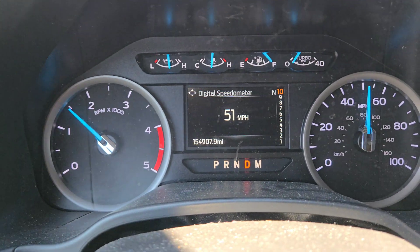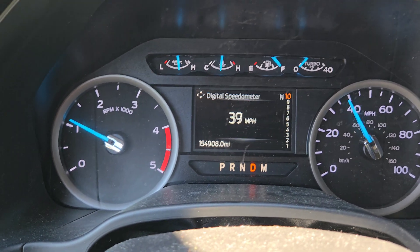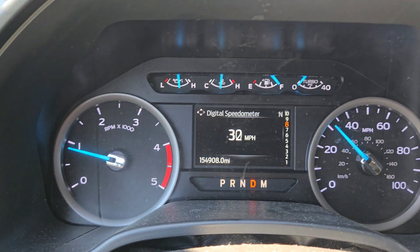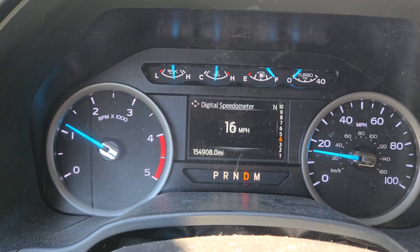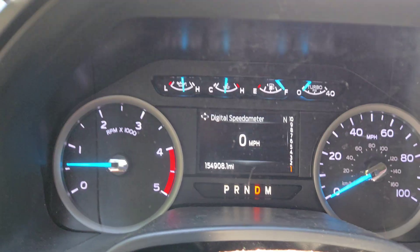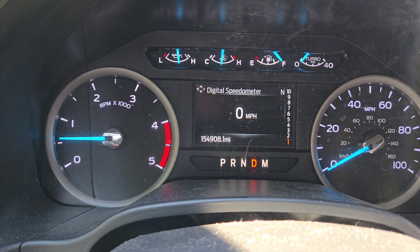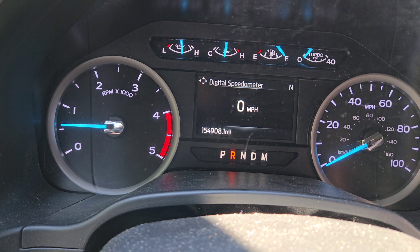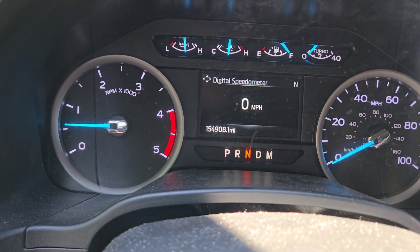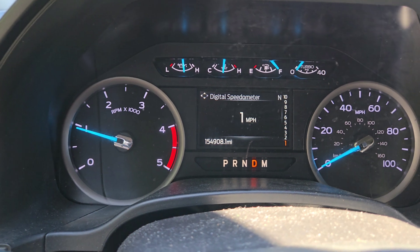There's 10th. Then I come to a slow stop. And I'm going to perform that procedure six more times. I forgot one very important part — once you're at a stop, you hold the brake for five seconds, neutral for one second, reverse for two seconds, back to neutral, back to drive. Then you repeat the process over again.